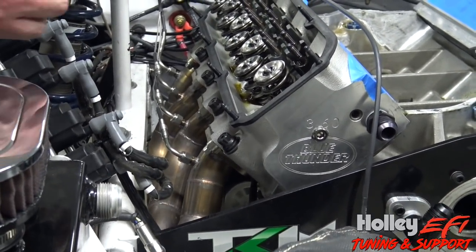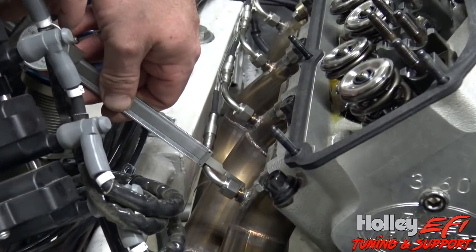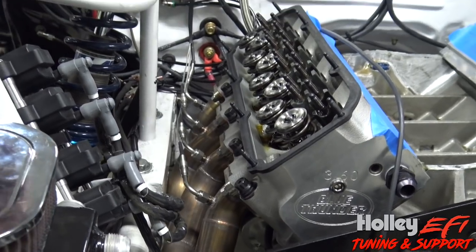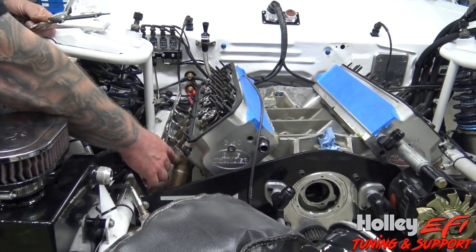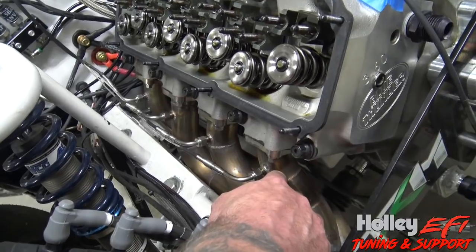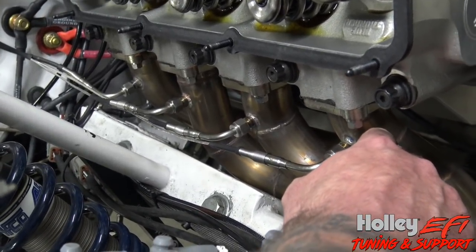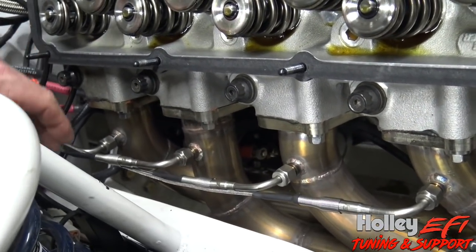So I rig up something to keep the probe center at 1.600 inches. We got lucky here that it lands from the curve to the base of the pipe at exactly 1.600 inches. You want to keep the depth uniform across all probes — if you move one in deeper or further out, your numbers will be way off. Even if they're not centered, just make sure they're all uniform. On big block cars with two-and-a-half inch primaries, the probe isn't long enough to reach center, so I do a little math to find a depth that's accurate amongst all of them.